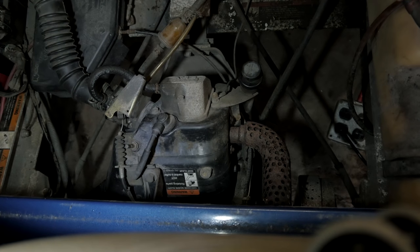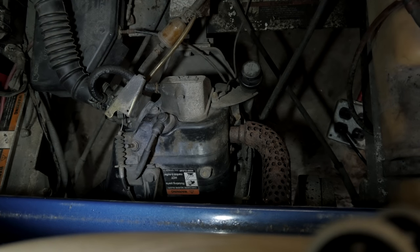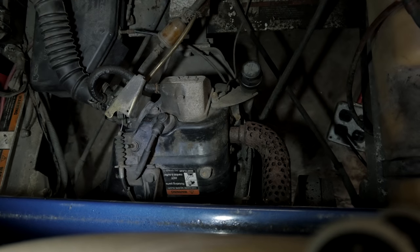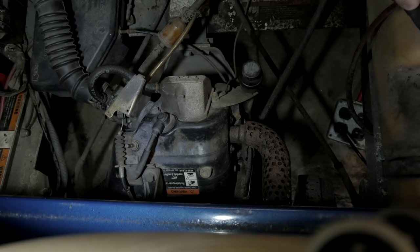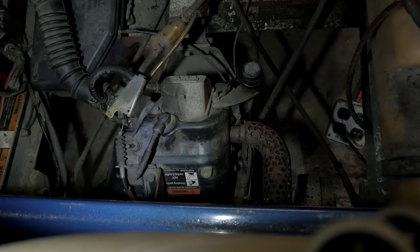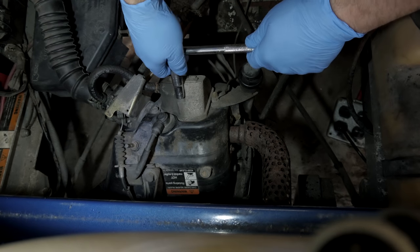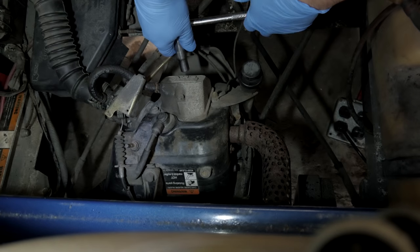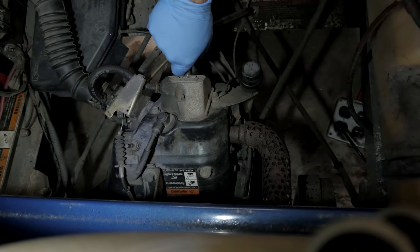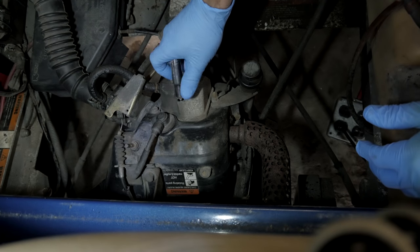It is kind of hunting, racing a little bit, surging — so I think we'll pull the carb and check it. We might even check the valves too because I don't know if this one has the hydraulic lifters or the mechanical lifters. I'll have to double check. Pull the cap off, it's only two 10mm bolts. Let's see what kind of lifters we have before we do anything else, because a lot of times it could just be the lifters are out of adjustment, if they're adjustable.